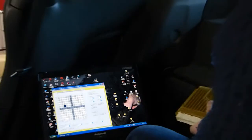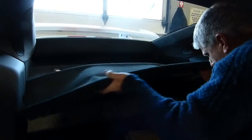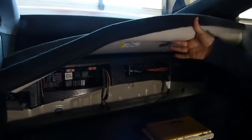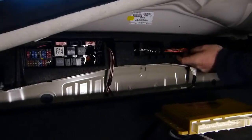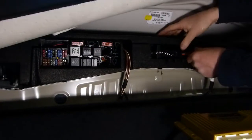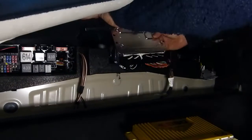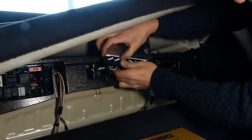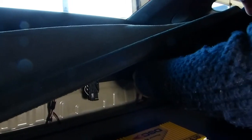Let's go into the install — I know that's why everybody's here. I've already loaded the file into this GT3 and we're ready. The first thing I'm going to do is carefully lift up the carpet set. You can see how easy it is — there are literally no tools required. You can see all of the ECUs and fuse panels are just suspended in foam. First thing I'll do is go ahead and remove the factory PASM computer, which is this device right here. It's not a very high-tech removal — first slide these tabs over, you can see they'll unlock. Then pull that one. Sometimes it's a matter of finding the right angle.